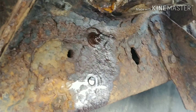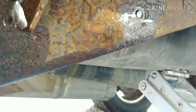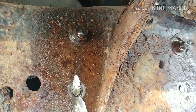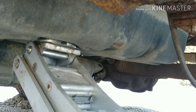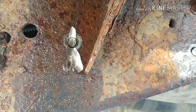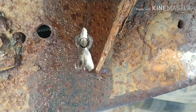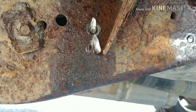We're back. I replaced the wires — didn't do any good. So I ground the two bottom bolts off because they weren't going to come loose. I soaked the top ones and they look like they've got good threads. I've got the jack under it to hold it. I did pour some gas down the carburetor and it does spark and tries to fire, so it's definitely going to be a fuel pump issue. That helps with the motivation.